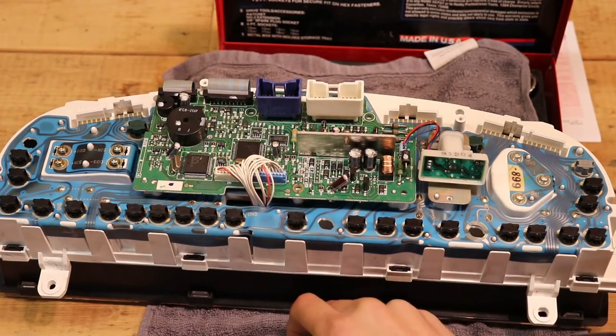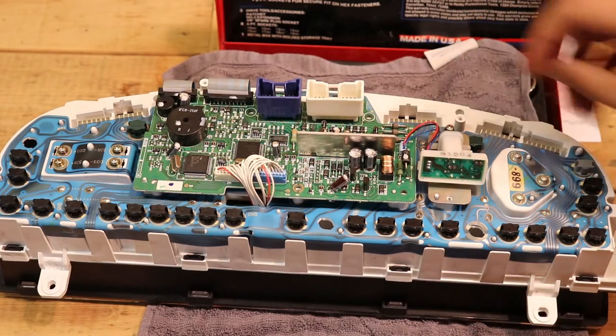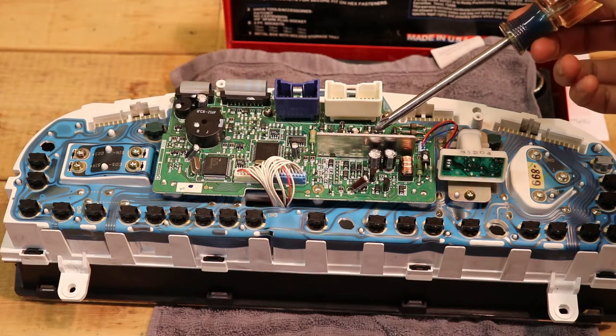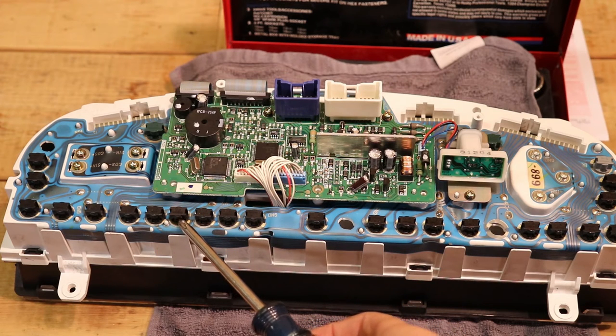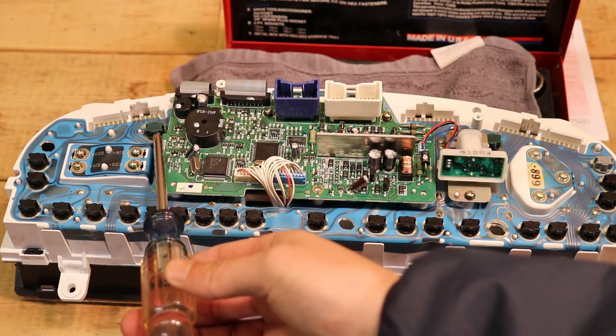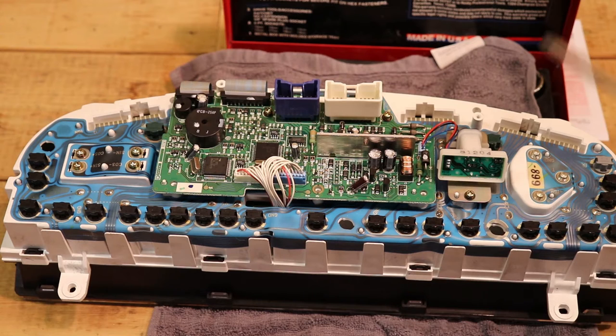Now that I have the new bulb in that middle slot, we're going to put everything back together just the way we took it off. Try not to lose any of the screws. Now we have this circuit board tightened back up along with the plate. I did want to mention there are three different types of bulbs, two of which we replaced — one black bulb, which is the drive bulb, and three backlighting green bulbs: one on the left-hand side, one in the middle, and one on the far right. The third bulb type is a gray bulb. All of these can be found on the diagram linked in the description.